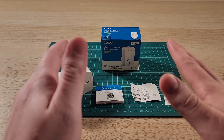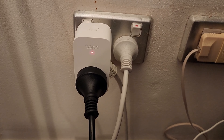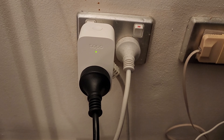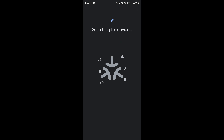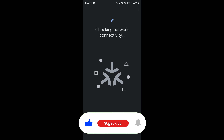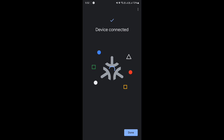I've plugged it in and it says I can use any Matter-enabled app to pair it. I'm going to navigate to Matter devices on my S22 Ultra and scan the QR code. It prompts for which Matter app to use — I'll use Home Assistant, but you might want Google Home. It connects to the device, sets up Matter credentials, and then connects to your Wi-Fi network. This took a few tries. Make sure you're on the same network you want the device on, and that it's 2.4GHz — it couldn't find my 5G access point.